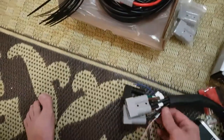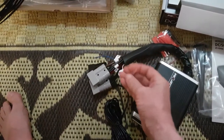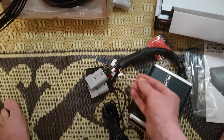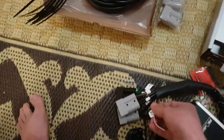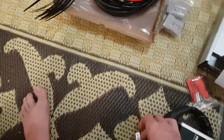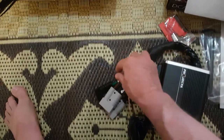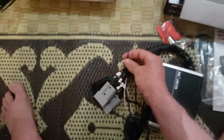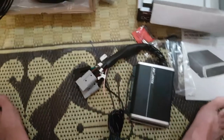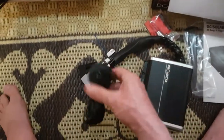The other two little wires you see — the pink one — that's if you want to run a little LED light, which you might protrude externally where you can see it, so you know what state of charge the unit may be in. The other one is for the ignition, so that's for if you have a vehicle with a smart alternator and you need to connect that back to the ignition in the vehicle.